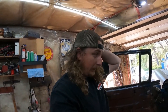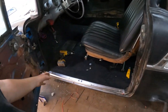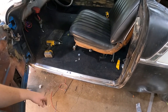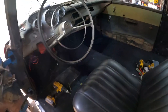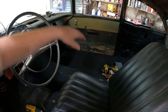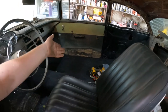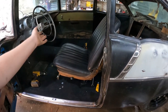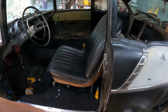I'm also going to put seat belts in this thing - I'm a believer in seat belts, lap belts at the very least. We got the sill plate in, which will probably have to come out because I'll be doing body work and painting in there, but I just want to see what it looks like. Now that I can sit in here, I'll set the shifter where I want it. I don't know if I'll do the other seat right away because I might have to build the brackets, but that side is simple - I already have the measurements, so I'll put it in and drill the holes and bolt it down.